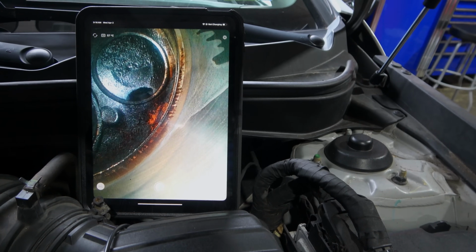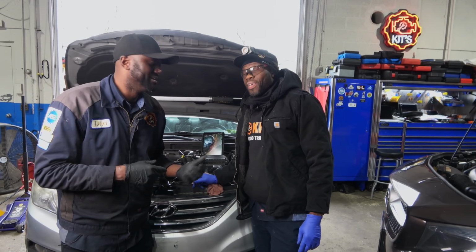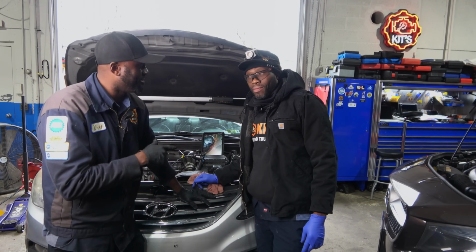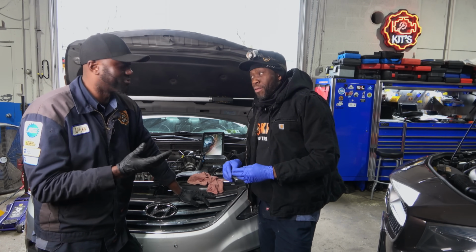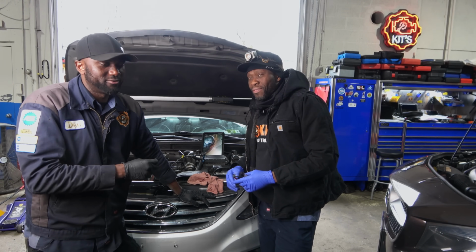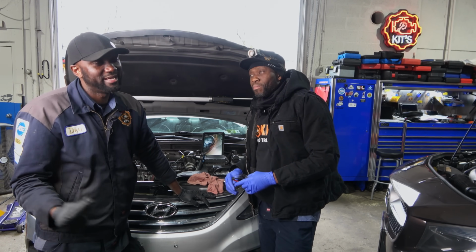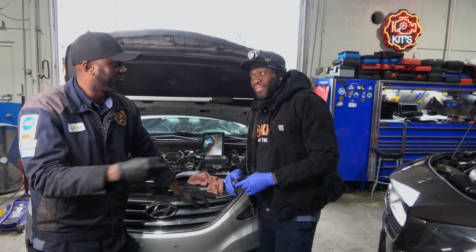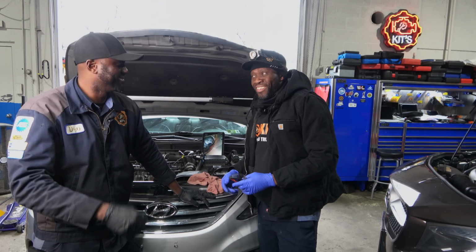We're good. That's it. All right, guys. So we're done with our diagnosis. I mean, we were done yesterday. But I just wanted to see what happened because when we finished doing our testing, I asked Robin, is there any other test we can do to really prove what went wrong? Before I called the customer, we knew we were missing compression in cylinder 3, but I was like, what am I going to tell the customer caused this? And then I thought about this test. I said, oh, dang, I have a bore scope. I could put a bore scope in the cylinder. If we don't see anything, then we can remove the valve cover to see if there's a broken valve spring. And then Robin was like, yes, let's do it.